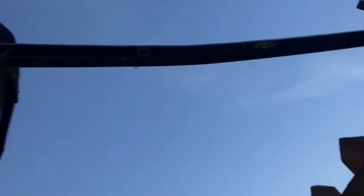I've exposed the nuts on this side by using two bars, threading them through to pull down the bracket itself — that's exposed it. I'm going to clean that up. By the way, these were 17s, so you need a 17mm socket. This one will be a 22mm socket again I think. I'll clean that up, get my socket on, and have a go at it.